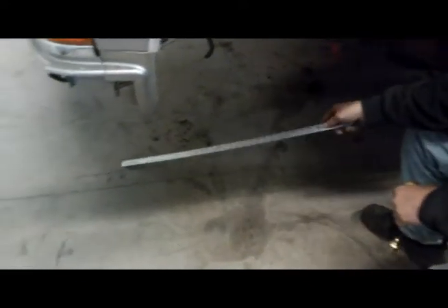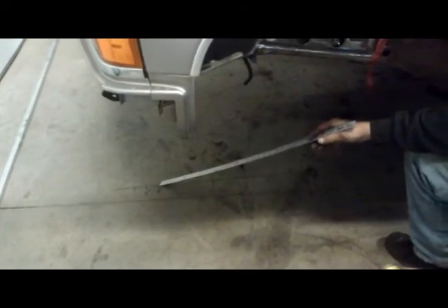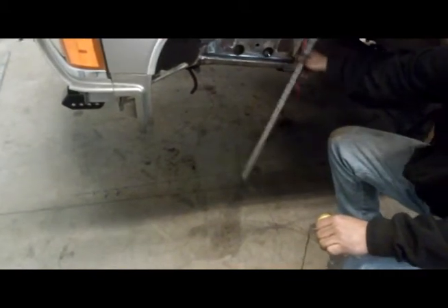You can see here I've got some marks up here on the floor. We've taken a straight line across — that's our axle centerline, and remember, this is at full compression on the suspension. From here I can measure: 26 inches would be the front half of a Chevy 52. Then this 24-inch mark — I went ahead and put that on the floor — that would be the front half of a Dodge 52, since they've got the two-inch offset center pin.